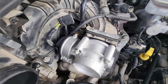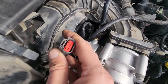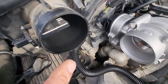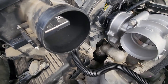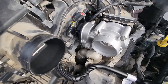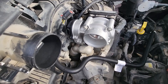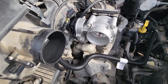It is also a good idea to clean all these connections — use a bit of electrical contact cleaner on the connectors. You can also clean the MAF sensor with MAF cleaner as well, because this is all connected. If your MAF sensor is not working properly, your throttle body will not work as it's supposed to either. You might experience symptoms like bad acceleration, rough idle, transmission issues, and things like that.